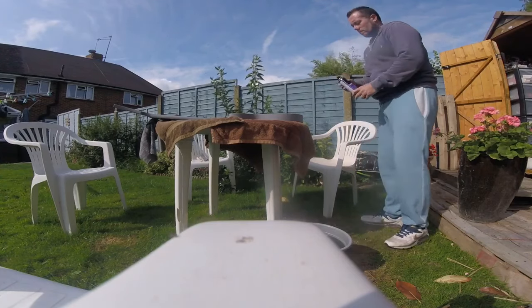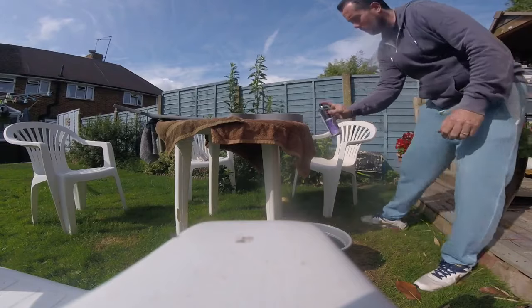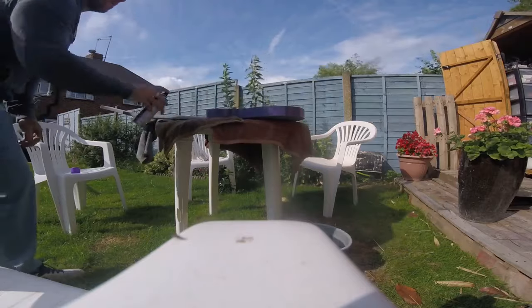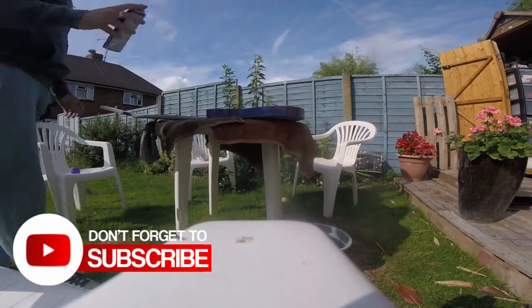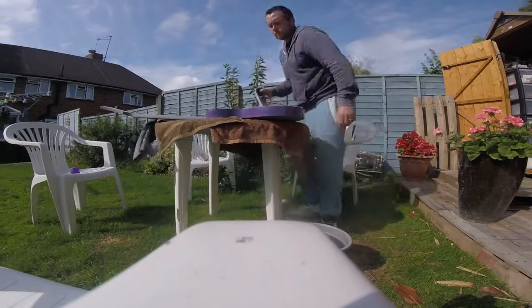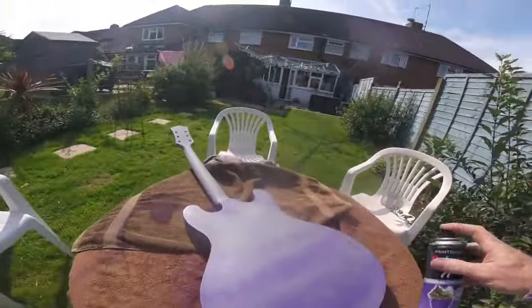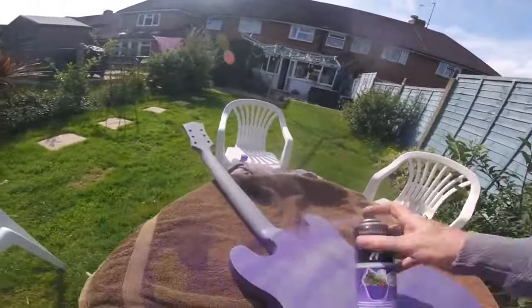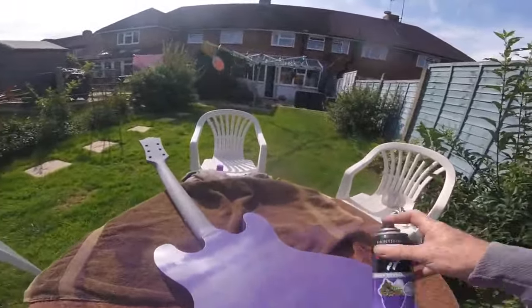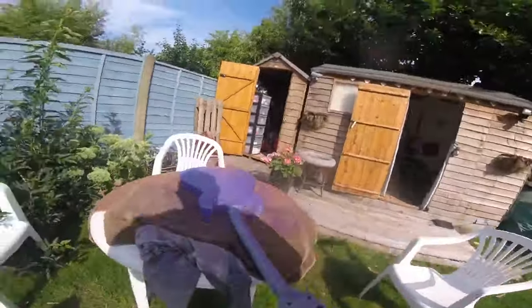Now we're on to the top colour. It's all primed, ready, and smooth. I'm just applying a bit of top coat — keeping it very light, so it's like dusting, really. Dusting the paint on and building it up in layers, and sanding between each coat with the 1000 grit. I tend to do it wet. Keeping it even and going in all directions so you don't get streaking — go sideways and go lengthways as well. Just dust it on so you don't get any build up.